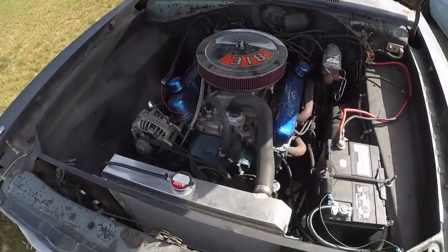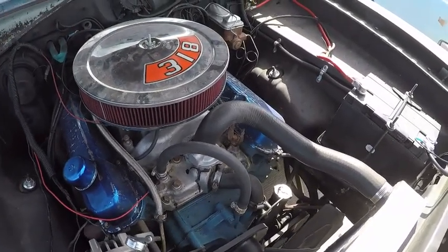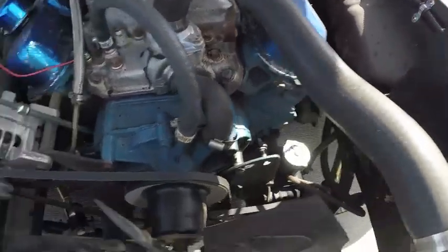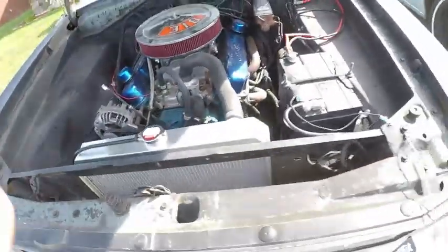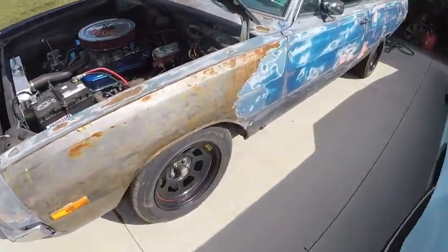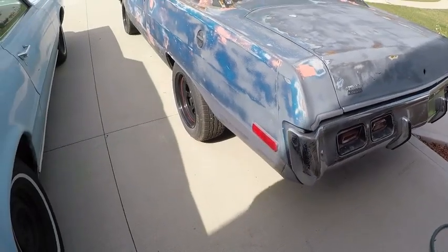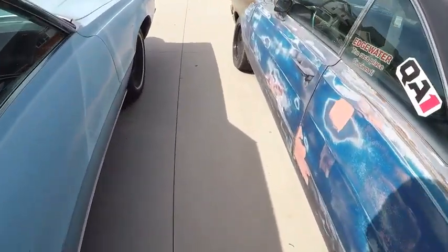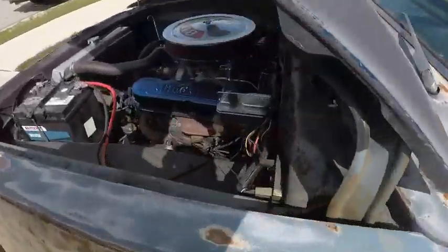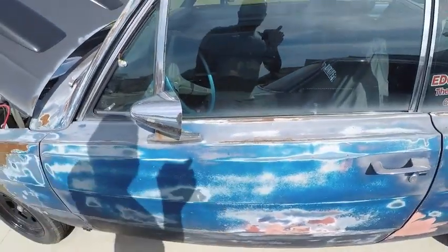She just has a hopped-up little 318 in it — cam, four-barrel Edelbrock carb put on it. And if you look down here, it's got all tubular suspension underneath of it. I put one of those Stage 2 QA1 suspension kits in it. She has an 8¾ with the 489 case, 410 Sure Grip. So she screams pretty good from stoplight to stoplight, though she doesn't like going down the highway at all that much speed. Got Hooker headers that go into a really short exhaust pipe and then into Flowmasters, and they end right there. So she's a little bit rowdy.